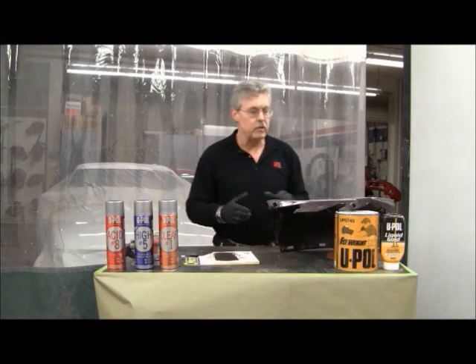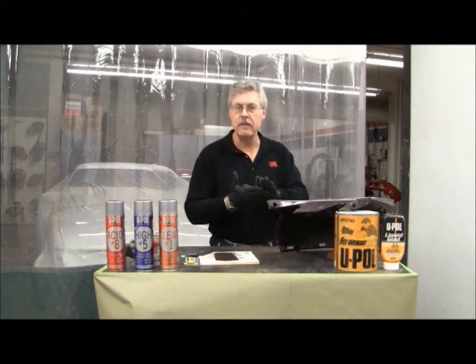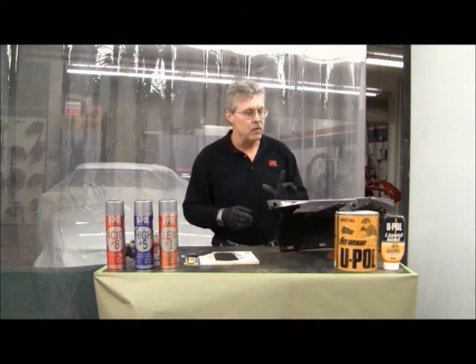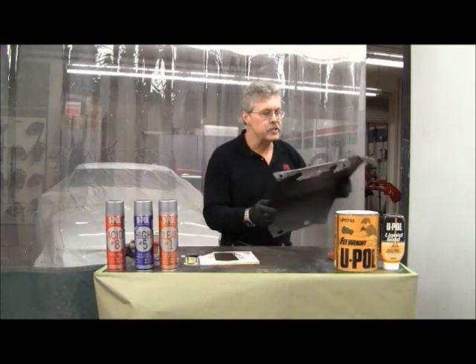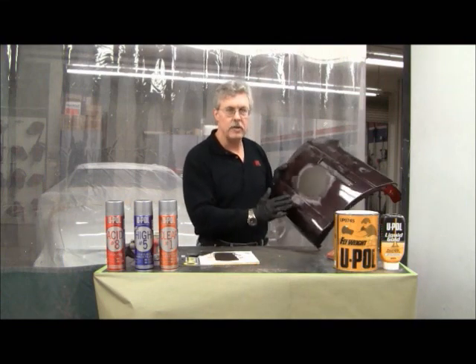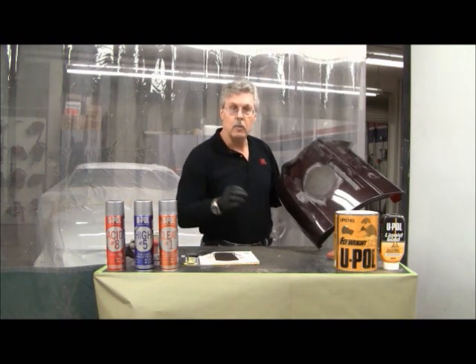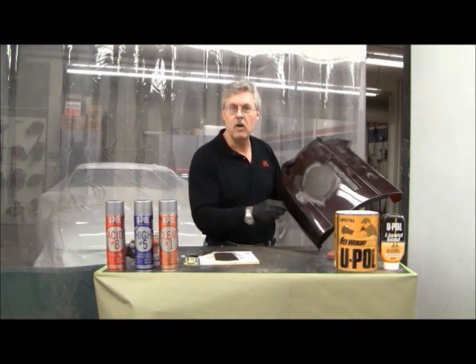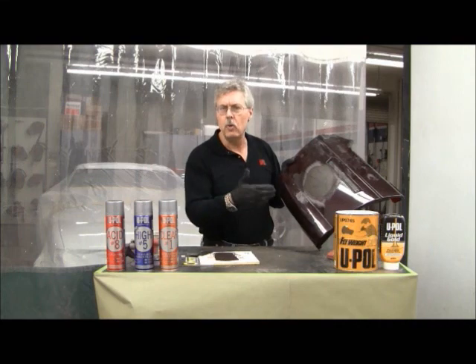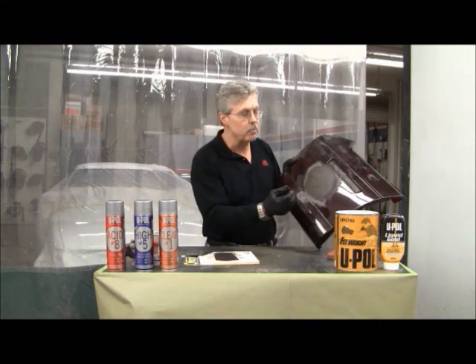As this product sets up, we don't use any wax or paraffin, so we go from wet to ready to sand in a very short period of time. One of the nice features about the 7061 is you don't chase that hard edge with this material. Once we start to sand this — either by hand or with the DA — it will perfectly feather into the TPO itself. We can take 80-grit, not only shape it but feather it right into the TPO, then come back with 180, 220, 320, whatever we're going to use before we come back and apply our primer on it.